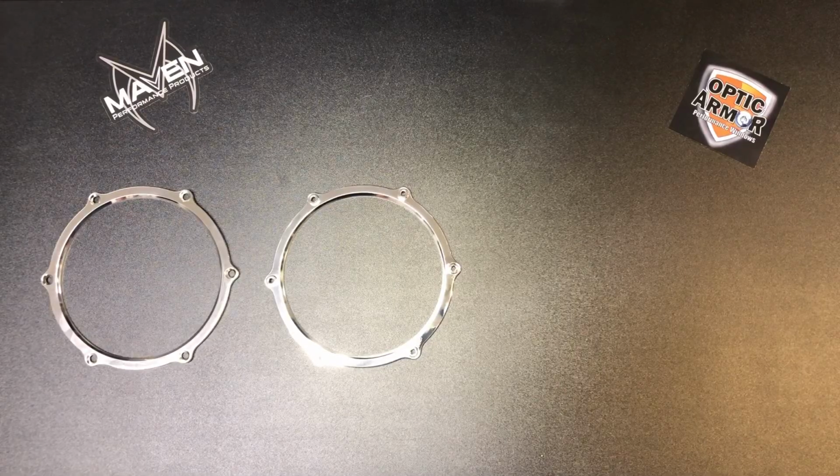Okay, so naturally the first thing you want to do is cut a hole in the window. As soon as you have your window installed and your door handle installed, you need to pick out a spot for the bezel to go. Now keep in mind that you've got to slide your fingers through there and rotate the handle back far enough to actually unlatch the door. So take your time and pick out just the right spot. There isn't really an undo button on that once you have a hole punched in there. So make sure you take your time and get that right.